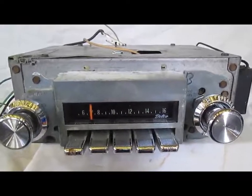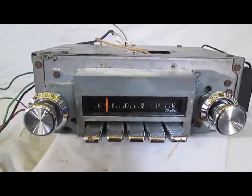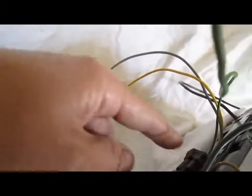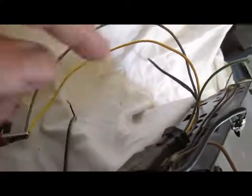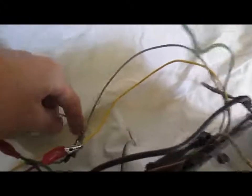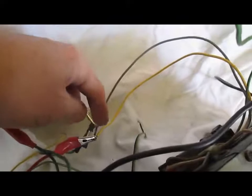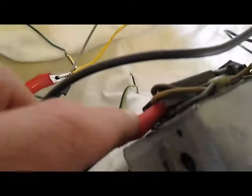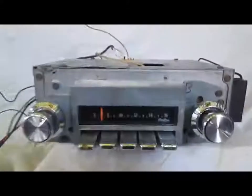This radio has the rear speaker fader option. We currently have it hooked up to the rear speaker channel. It's a real easy hookup — there's a lamp lead, which is the gray wire. The connector is a test connector, so your car's wiring harness should have the connector on it. There's a wire for the lamp, a wire for power, and a wire for the front speaker. This connector doesn't have the wire for the rear speaker, so I have it hooked up directly to the radio. We'll start off on the rear speaker, then I'll show you the front speaker.